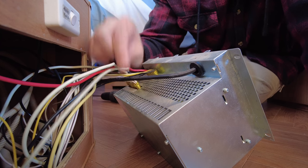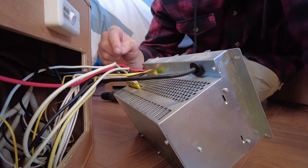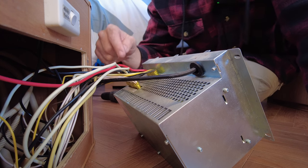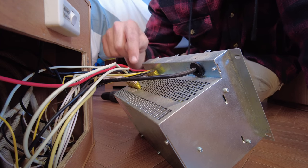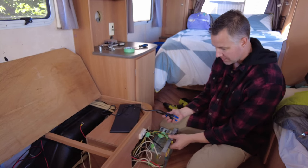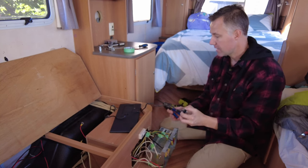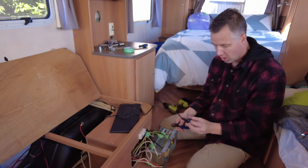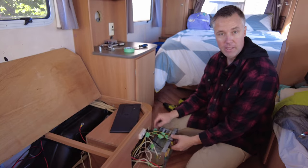There's just the 240-volt cable for the charging function, and then all these wires here are the 12-volt side. There are a number of wires into each terminal — like four going into one and three into another. The corresponding fuse at the front should match the terminal at the back. I've labeled all the wires on the back of the CTEK unit. The hole they've given me to pull the plug through is a bit slim, so I'm just going to cut this end of the plug off, which will allow me to pull the CTEK unit through.